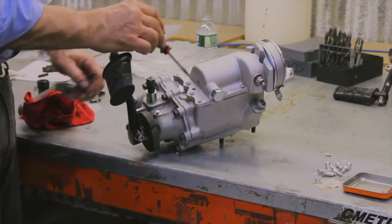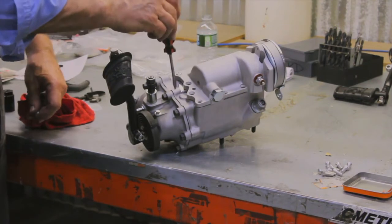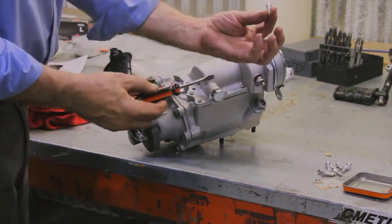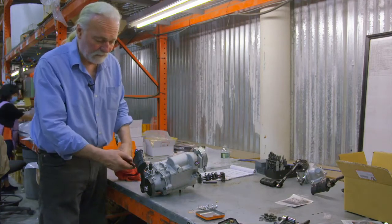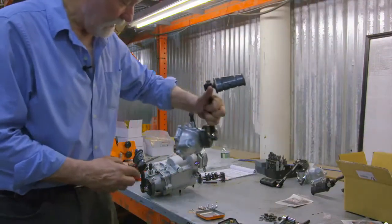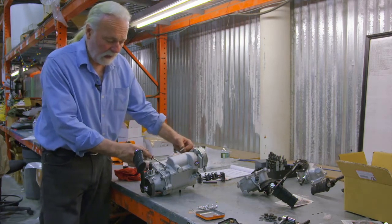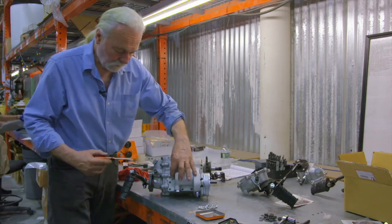This remanufactured case has the blind boss, where in 1941 and later, that little vent is moved over to this position here. This being a later retro case, we could utilize a vent stud. This is bored right through the center and then out the side as a vent. That would locate in this case, say we didn't have this cover where this was just a regular blind cover, as we see here, without a vent. We've got no vent in position, so we've got to ventilate our transmission. There's a specific location behind the dowel. Here's our locating dowel. This will locate right here toward the back of the motorcycle.